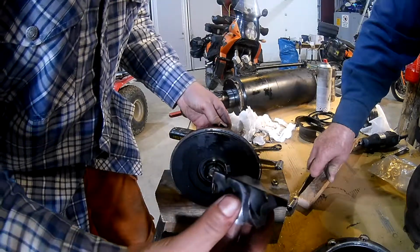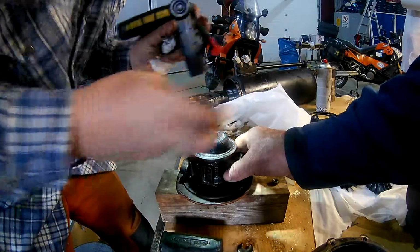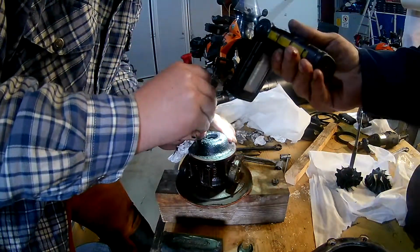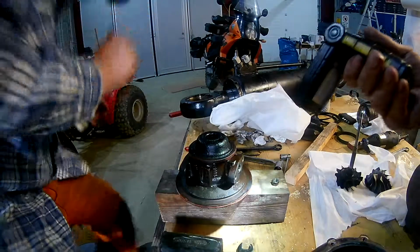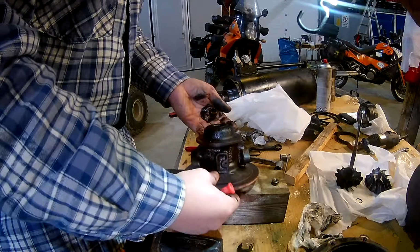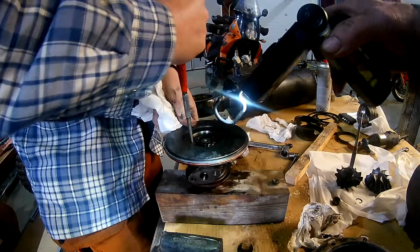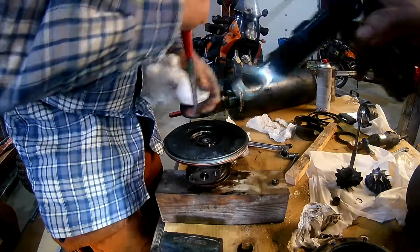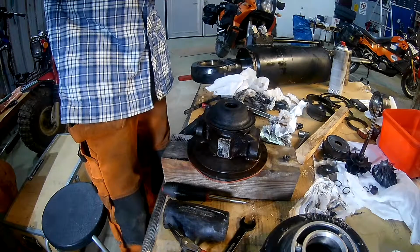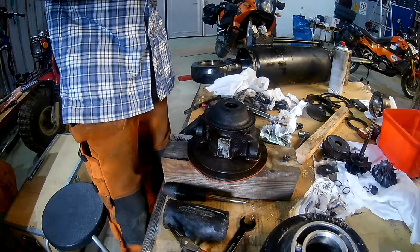I spent some time taking pictures and making a few notes exactly how to put the impellers back in place and get that properly lined up to not lose balance. It was mainly the solution about putting some pressure, pushing things apart. We made sure we pushed only on the housing of it and the outer part of the exhaust side, and not stress the aluminum intake side.